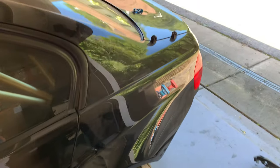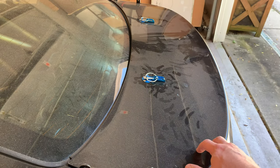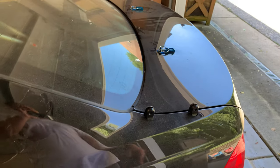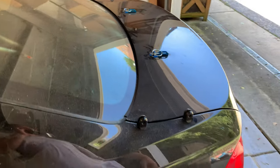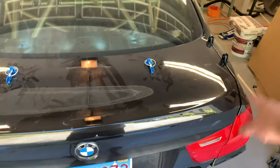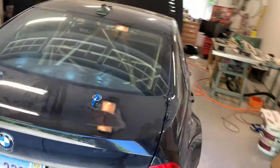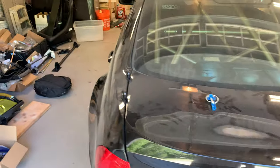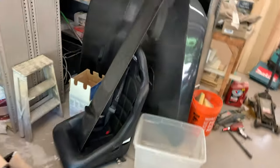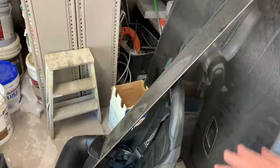If we look around the back here, you'll see these guys right here — this is kind of unique. These clevises right here actually mount a structure that was built directly into the frame rails inside the trunk, same on both sides. That's actually going to be the mounting points for the uprights that come up for the wing itself. And here — this is a total mess right now — but this is actually the wing. This is an AJ Hartman carbon fiber single element wing. It can be upgraded to a dual element to fit that as well.